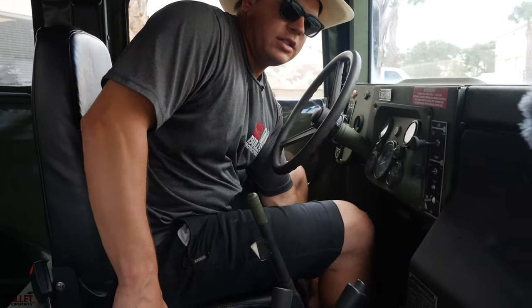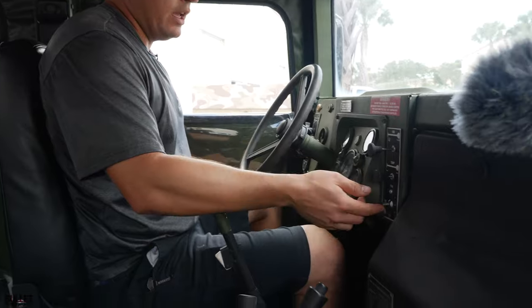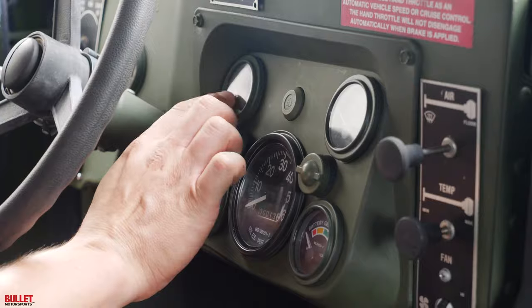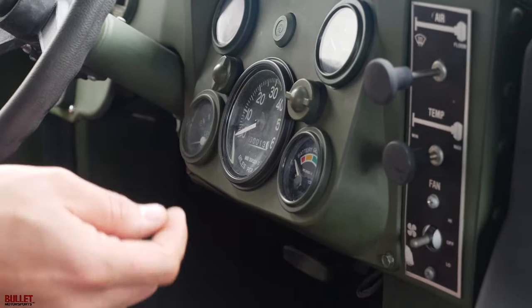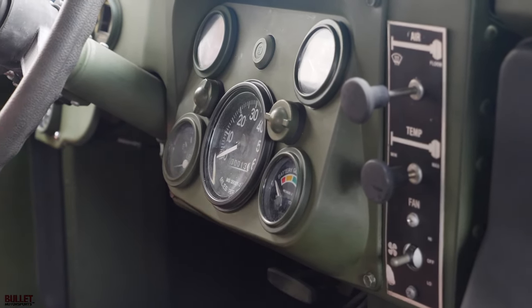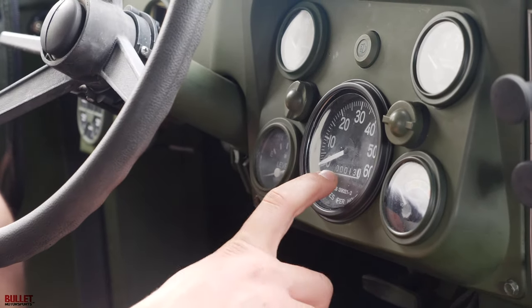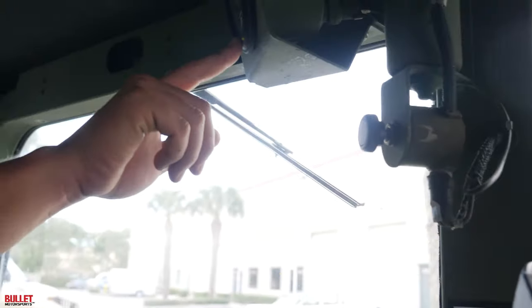We're inside the cabin right now. One cool thing about high-back seats is you have the adjustability to go up and down without getting out of the vehicle like the regular-style seats. You also have your gauge pod right here with all new gauges — you've got your oil pressure, water temperature, your generator, which should be in the green when you start it up. You want to watch if it's bouncing, because that'll tell you some regulator issues are happening. Then your fuel gauge, which needs to be checked out. We have 13 miles on the motor, and you've got your tachometer.